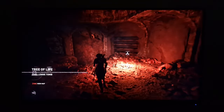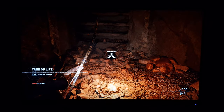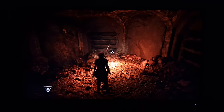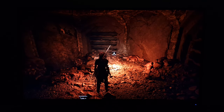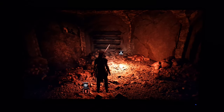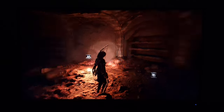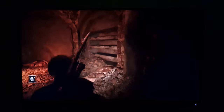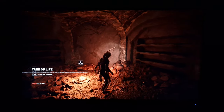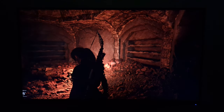When I look at brighter shades, there's a certain graininess to the screen surface — not the grainiest I've seen, and it doesn't have an obvious smeary look or obvious layered appearance in front of the image. As I mentioned, it's a light to very light matte anti-glare surface, which means the light from the monitor isn't diffused as heavily as on some matte surfaces. This helps preserve clarity and vibrancy a bit better.